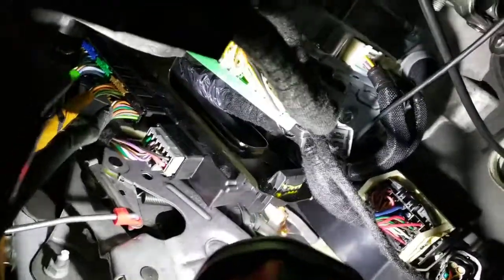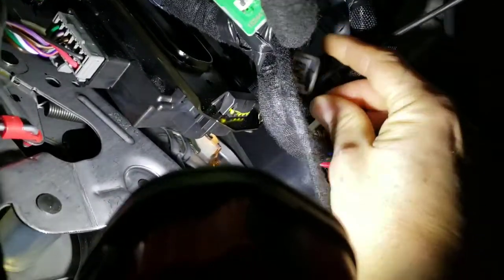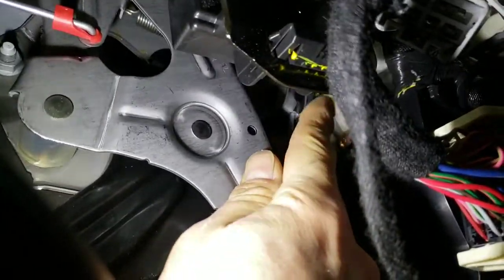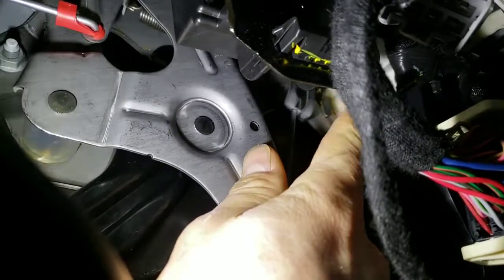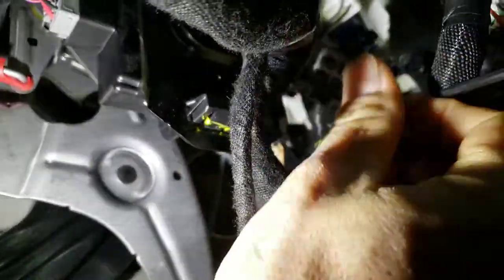Next is the gray plug that comes in your kit that has the purple, two reds, and two pink wires. This one they were nice enough to leave out for us. Up in here is our steering shaft, and here are the plugs we just put in. This gray plug is the next one we're going to connect. Now this one's really nice — we're fortunate it's hanging out here. It's usually stuffed way back in there and zip tied to another wire so you can't even get to it. It's a pain to cut the zip tie and bring it back down.